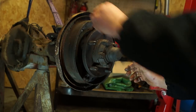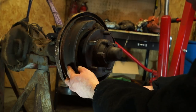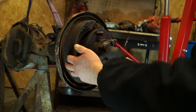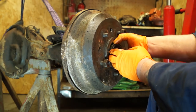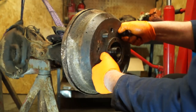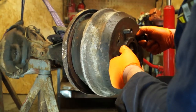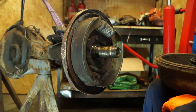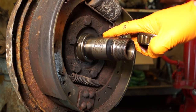What I usually do is not bother with this situation because it's a real pig to get the springs off. I'm checking here to see what sort of condition the brakes are in — they have got oil on them. What I do, just to cut things short, is take the half shafts out, slip the front bearing out, and then wiggle to get the drum and the hub off in one go. This is my preferred way because then I get a whole lot together — the shoes, the wheel cylinder, the springs and everything else are exposed. The bonus here is you can also check the stub axle.